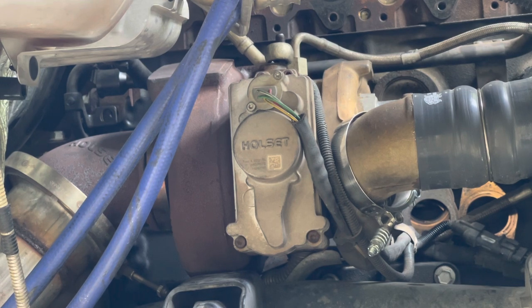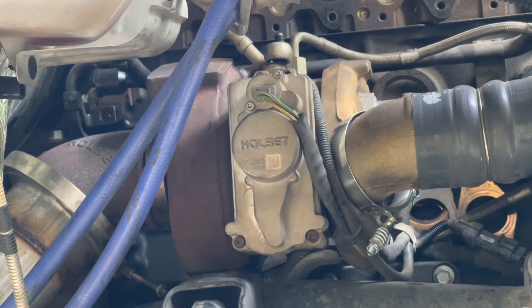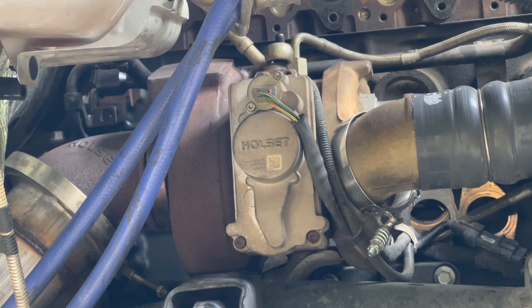You've got all that fuel but you can't get the air in to burn the mixture, because the turbo is effectively stuck closed like a small turbo. We think we have some vane damage in there. We watched a lot of YouTube videos and they didn't explain much, or people say you have to reprogram things. Hopefully we don't - we're going to remove the actuator, set it off to the side with the batteries still hooked up, and focus on the mechanical side of the turbo.